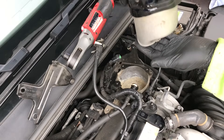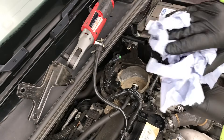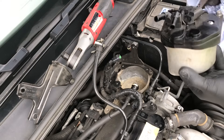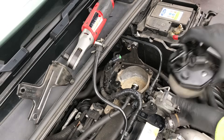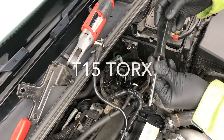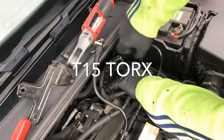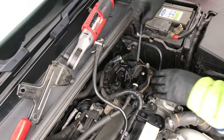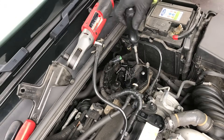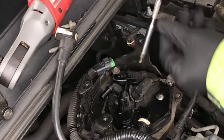There it is — that's the actual assembly. We've got to get inside to get the fuel filter element out, so just wipe off a bit of that diesel. The top is held on with three T15 screws. These are really tight — a cheaper screwdriver won't cut it. I had to get the Snap-on out and even then they were really tight, but I was able to crack them off.